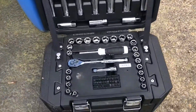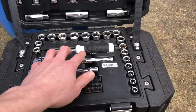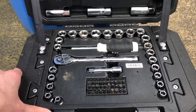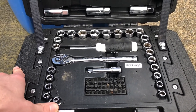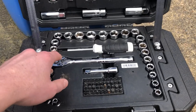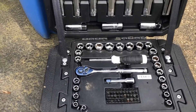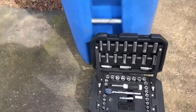Next you're going to need some tools. This car has a skid plate underneath, so you're going to need a ratchet not only for taking the drain plug bolt out, but also sockets for taking the skid plate off. The skid plate bolts are 10 and 12 millimeter — so you'll need those sockets. This is a 3/8-inch ratchet. The oil drain plug bolt itself is an 18 millimeter — actually I'll confirm the correct size later in the video. I recommend having a full ratchet set to make it easy.